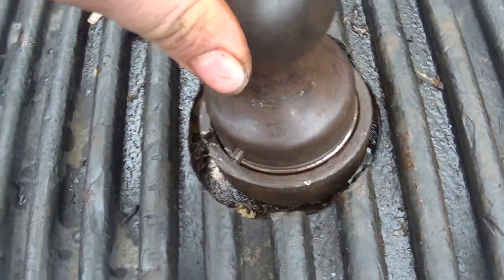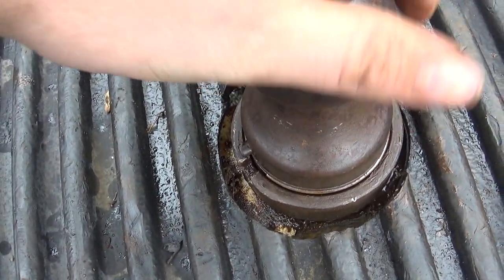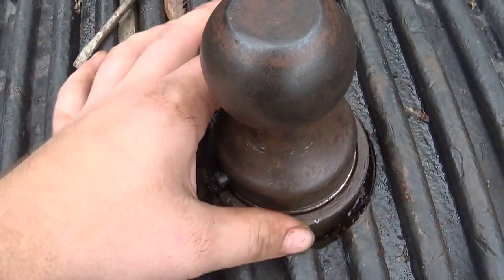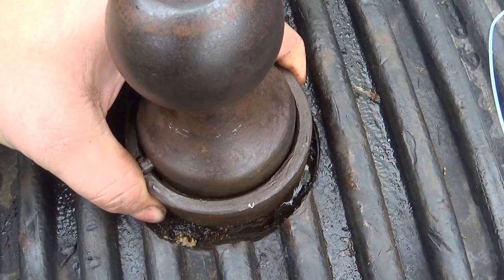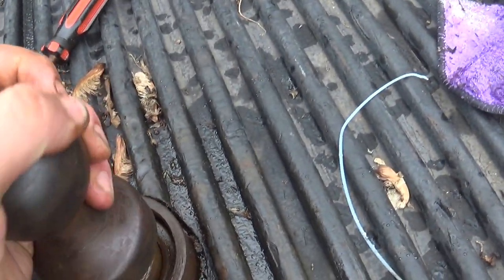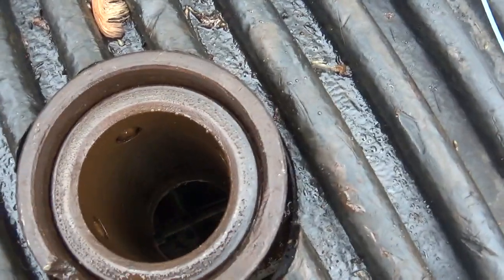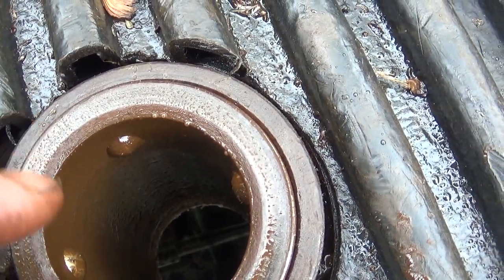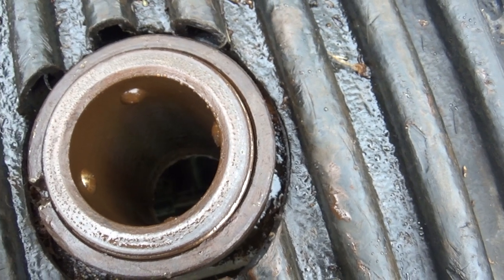In order to do it, if it works for you, you bring this notch here and slide this around until it's lined up with this notch. Then you pull up on this collar here and you can just pull it out. There are four little balls in there that catch in this groove here — that's how this one's held in.